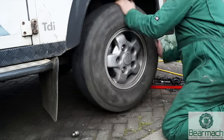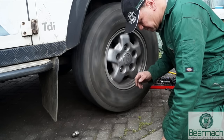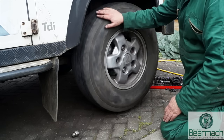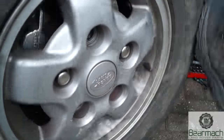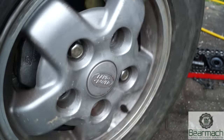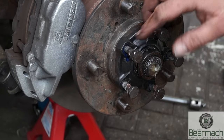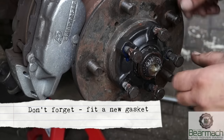Once that's been tightened up, we can spin the wheel quite fast and have a good listen to see if there are any rumbly noises. This way you can tell if a bearing is pitted or damaged. On this specific bearing I don't think you'll hear anything because it's in very good condition. If you heard a rumbling then your bearing would need changing. We do have a tutorial on changing wheel bearings, but these wheel bearings are okay, so we'll go ahead and fit the bolts back in.